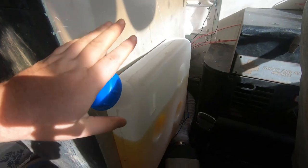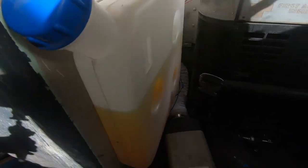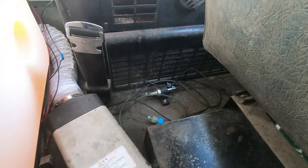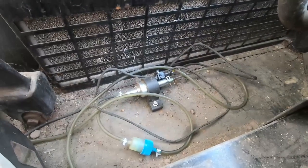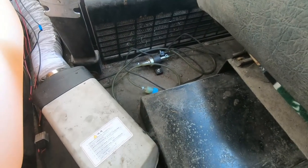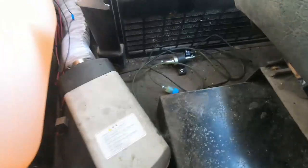I've got the diesel tank that comes with the unit, it's just mounted on the wall here. And there is the fuel pump. If you guys have a bus with a rubber floor mat, that's the best place in the world to mount that pump — it is totally quiet. The heater makes more noise than the fuel pump does, which a lot of people complain about the pump. It's got a rubber mount and mounted into rubber, so it is silent.